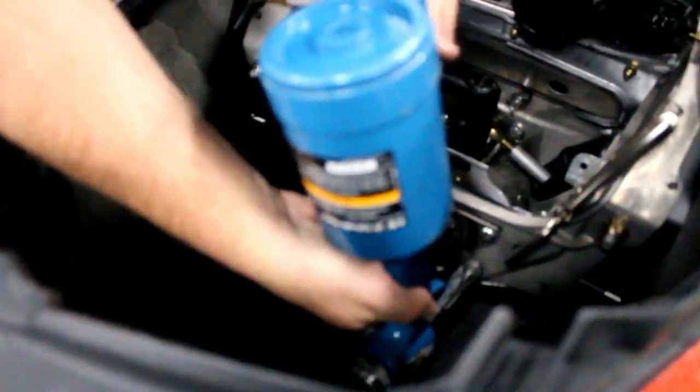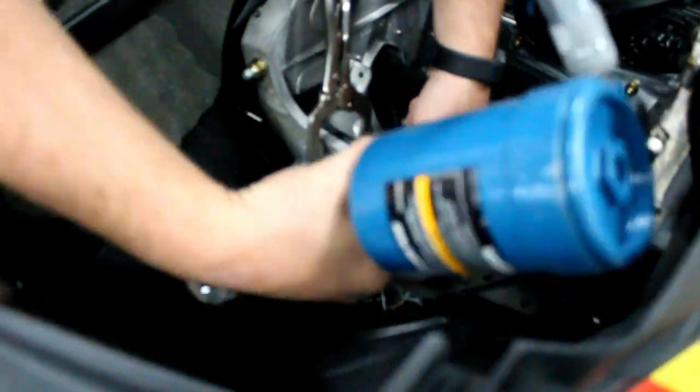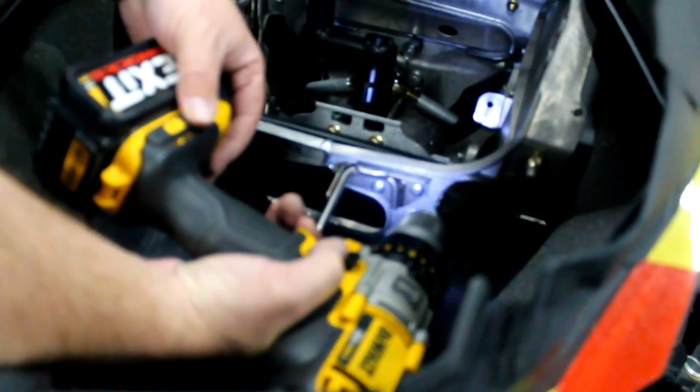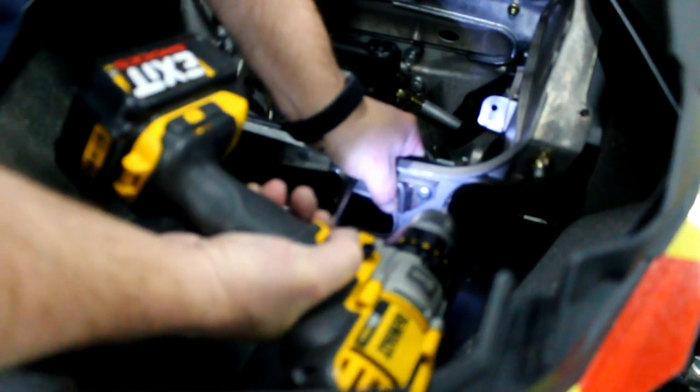In the kit, you got some 0.25 inch steel rivets. I'm gonna pop a couple of these in and finish drilling. Using an air riveter is usually the easiest way to do this. Now I can undo the clamps and finish drilling the last hole. Now we have our plate installed with our 5 rivets and we're ready to move on to the side plates.